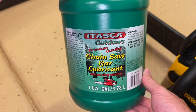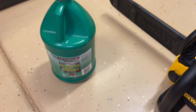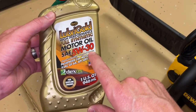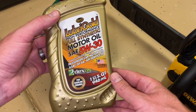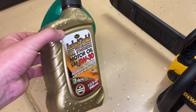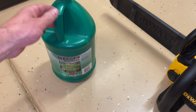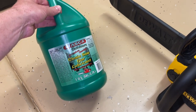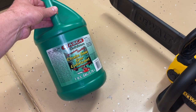They have different kinds and I would research and find exactly the one that you want. This is some of the bar and chain oil that I had. The manual also recommends that at worst you could use 30-weight motor oil, but motor oil that doesn't have detergents — and that's going to be pretty hard to find, so I don't think that's a really good option unless you're in some kind of emergency. Just remember the kind of oil you use will essentially be getting into the tree that you're cutting.